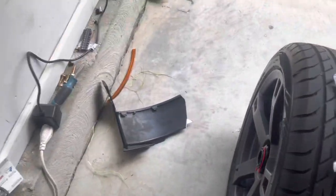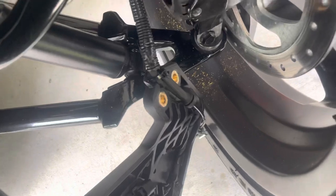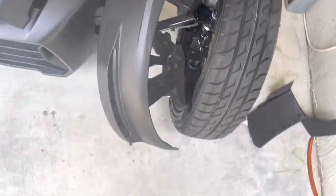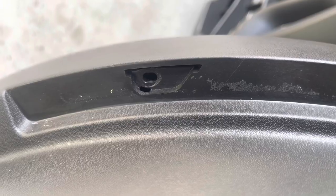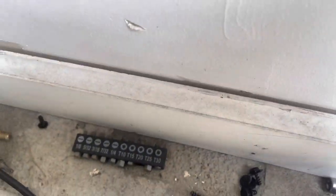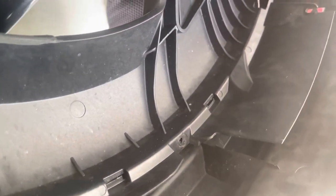Just to follow up with you guys — the very first thing I had to do is unbolt these 4 bolts right here, using a 13mm. Once I got that unbolted, there is a screw behind the yellow reflector — that black screw there. Then I was able to loosen up the whole fender. There are 2 other bolts plus more inside the fender. Once I got those out, the last part is literally prying apart the fender, and that's pretty tough — it's taking a lot of time to un-pry that.